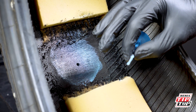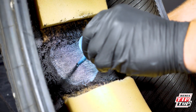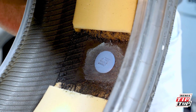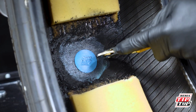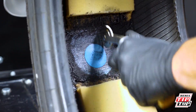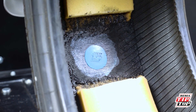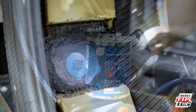Now you're ready to insert the repair unit. Once inserted, pull the repair unit until the base is completely flush with the tire and dimples against the inner liner. Thoroughly stitch the base from the center outwards to remove any trapped air. Now use repair sealant around the entire repair unit to seal it into place.